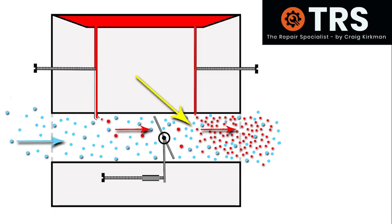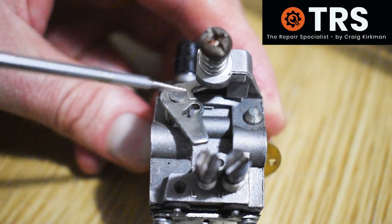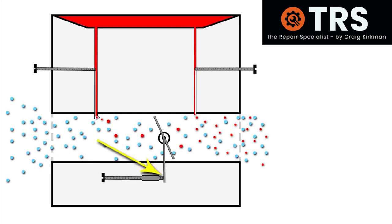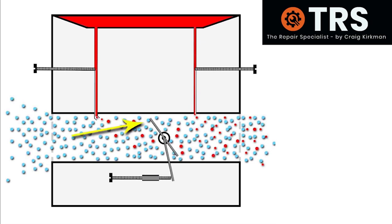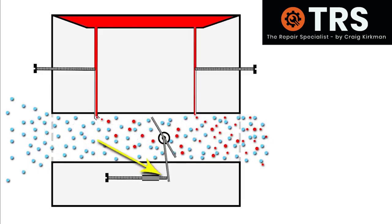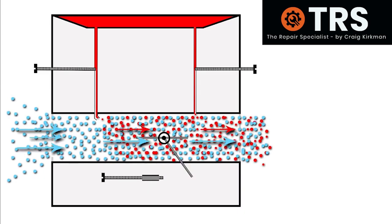Now we've had a look at how the rich and lean adjustments of idling works, let's look at adjusting idling speed itself using the idling adjustment screw. Adjusting the idling screw in clockwise mechanically pushes on to the lever of the throttle butterfly, and the more it screws in the more the butterfly opens, allowing more air into the carburettor which pulls out more fuel out of the main jet — as a result engine revs raise. This speed would be too fast for the chainsaw to idle because the chain would be moving, so to adjust it we turn the screw anti-clockwise, closing up the throttle butterfly and reducing air — engine revs lower again. Getting a happy medium with the idling speed is a must: not too high that the chain is turning, and not too low. I want to thank you for watching the video, which I hope you found interesting and educational. Please like and subscribe and I'll be back soon — thank you for watching.